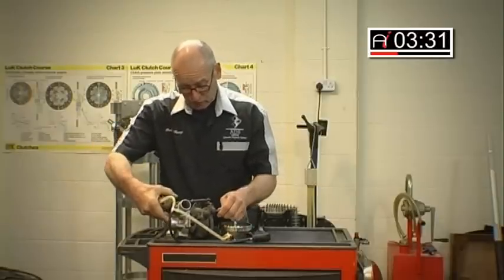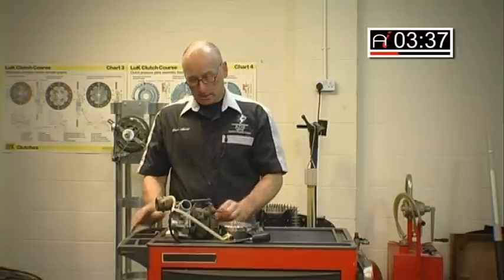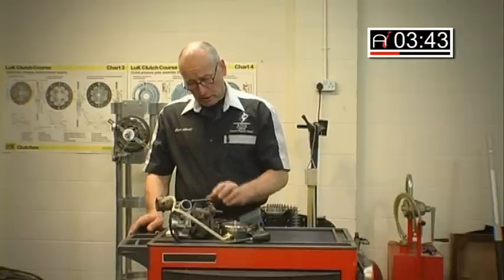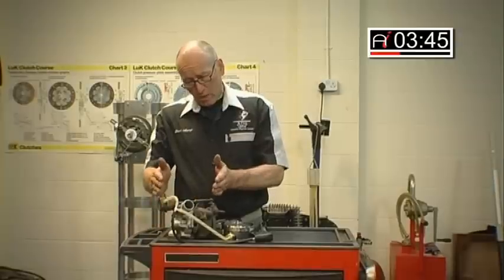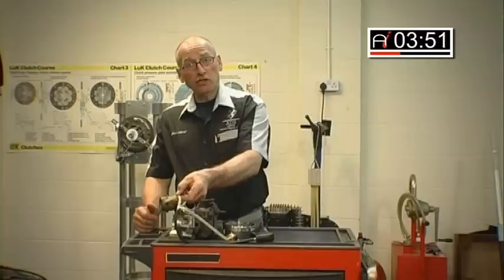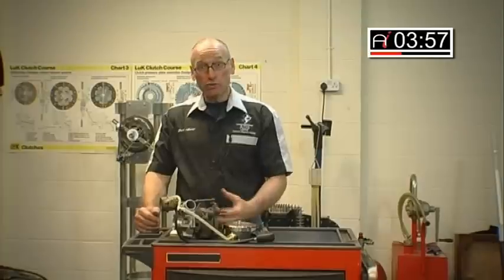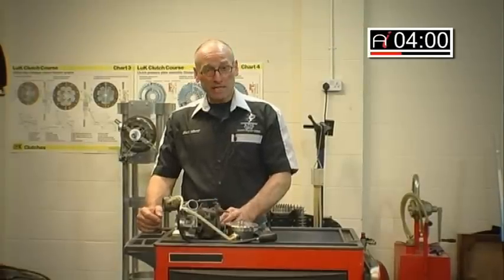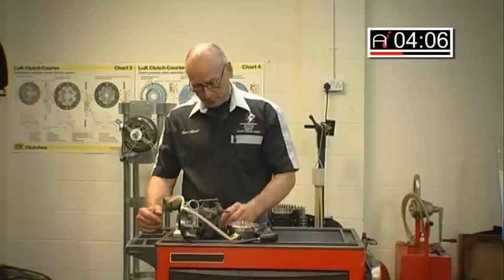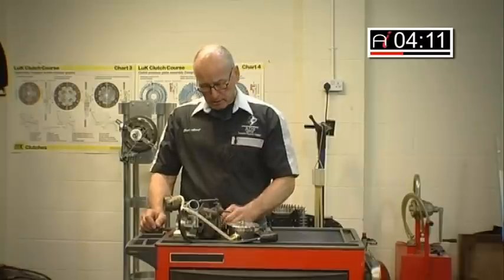What I'd like to do now is talk a little bit about how the turbo is controlled electronically. Its basic functionality is obviously mechanical, but through the software this wastegate mechanism is controlled by allowing the control of pressure to be applied under computer control. The software looks at what they call request values — request is a load request made up of a number of inputs from sensors: accelerator pedal position, air mass meter, engine speed, load. The calculation is then formed as to the correct boost requirement based on that request.